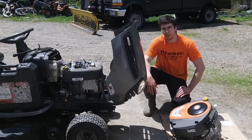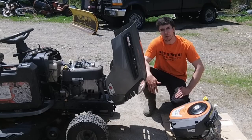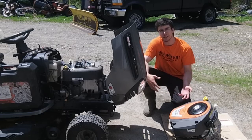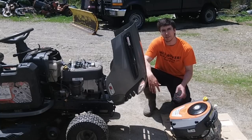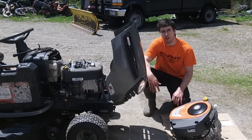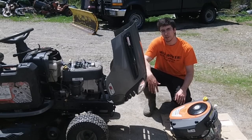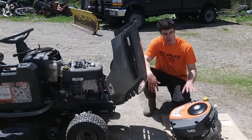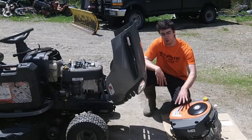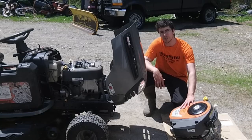Hi everyone, Redneck Computer Geek here. Today we're going to be covering a basic Briggs and Stratton single-cylinder engine swap. Most Briggs engines are pretty simple to swap — they've all got basically the same generic wiring harness, the gas lines are usually on the same exact side, and the solenoid for shutting off the carburetor usually has the same wiring. So they're pretty simple to do a swap on a machine of this nature. I'll post a link in the description for the unboxing of this engine along with more info, but this is basically just your generic single-cylinder Briggs.